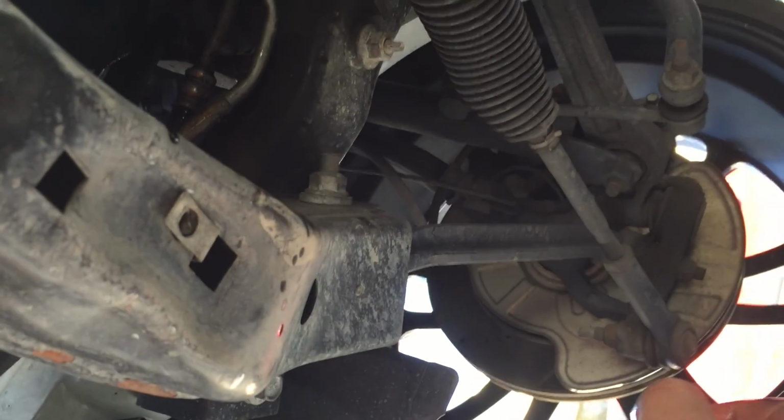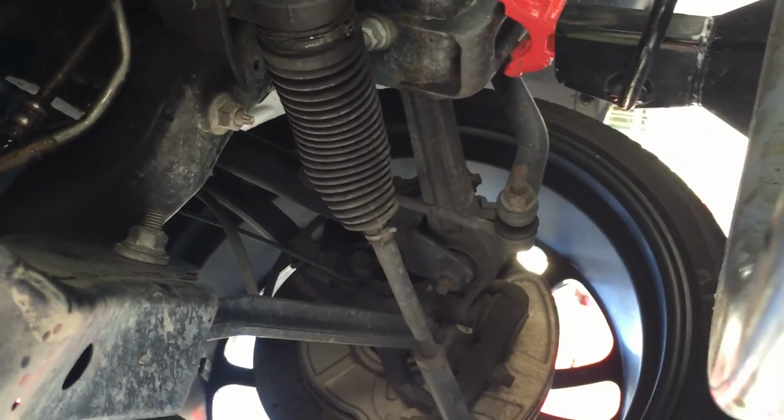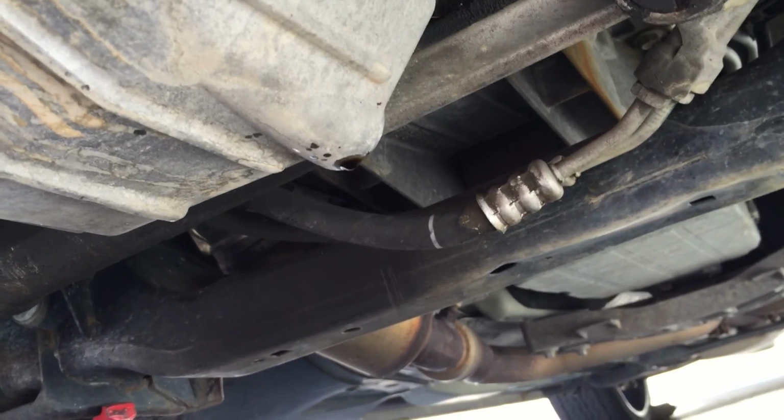So there's our spot. So you can just hand tighten it, give it a nice squeeze. I don't know, I'm a big guy. If you guys need to use an oil wrench, it could be better as well. I usually can just get it on as tight as I can with a hand tighten, and that'll do good enough. Again, it's still draining a little bit. When that's completely drained, you can put the cap back on that, and then we'll start putting the new oil into the vehicle.